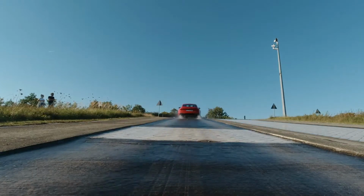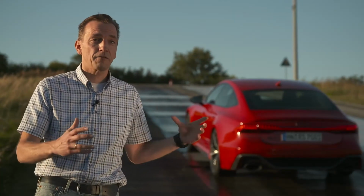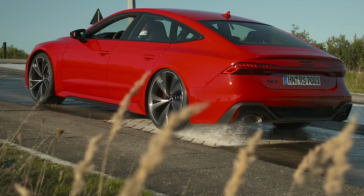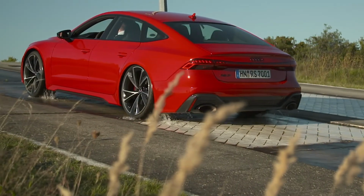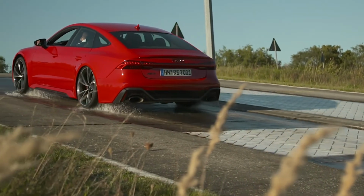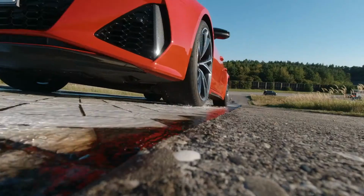And if my rear axle is on ice, all of the torque that I need to get this heavy vehicle up the mountain must be distributed over a single axle. This means that the center differential needs to distribute the torque and balance out the rotational speeds with a full engine load all at the same time. Of course, that is an extreme load for this part, but it must be able to do it and must not suffer any damage.